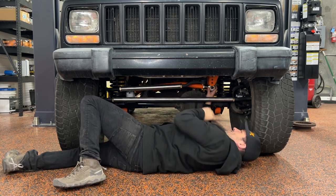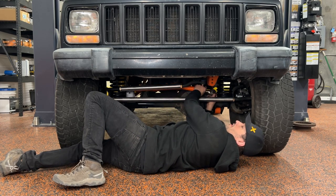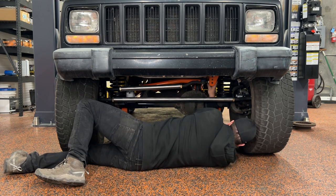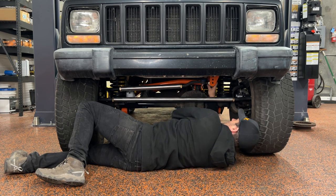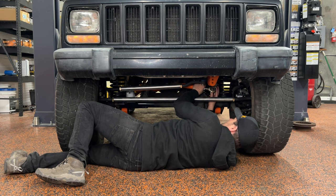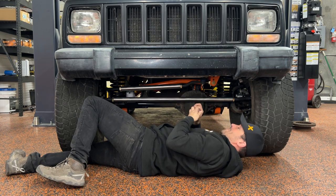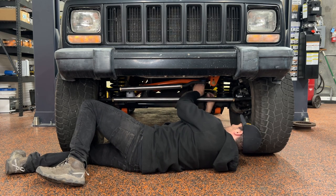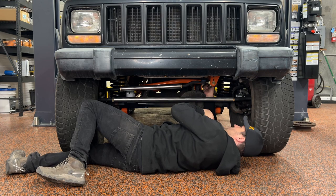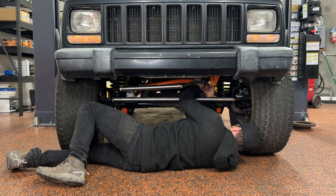So I'm spinning this out. We need to adjust out because we're pushing the axle to the passenger side. We might be a little off because the springs are going to settle a little more, but the idea right now is to get it close enough to drive it. It's important to have a friend — doing things like this makes it a lot easier. When you're doing any sort of track bar work, having someone turn the steering wheel left and right can really help you line up the bolts. You're not having to use ratchet straps or fight the weight of the vehicle — you're using the steering to solve that problem.